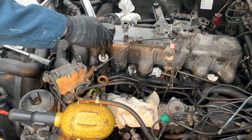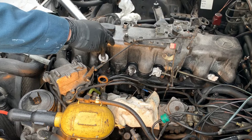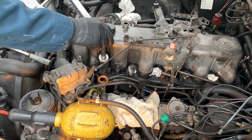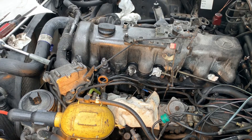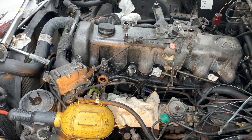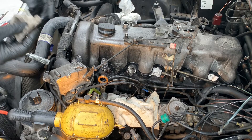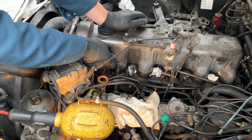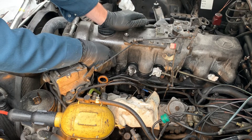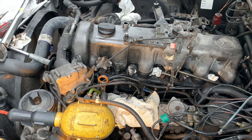So that's 52 right there. I'm going to take the inside of one of these paper towels and just place it over the injector once it's in — the inside is clean. That'll cover up the injector and make sure nothing falls into the return line or the input side of it.